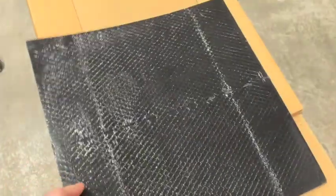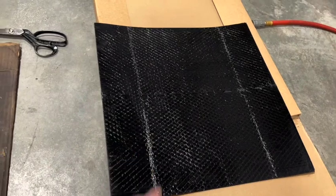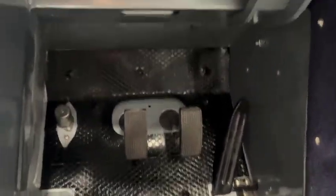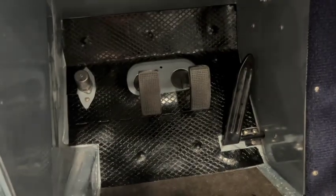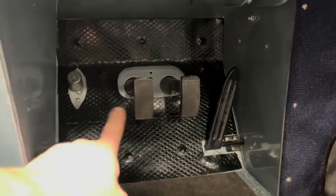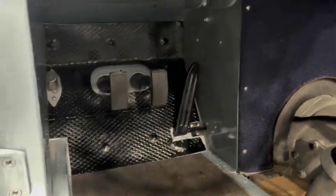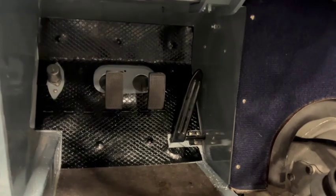They're just black on the surface, come in 24-inch squares, and are perforated down the center — really easy to cut with scissors. I'm taking my jute insulation, laying it on here, chalking it out, cutting it out, and making a mirror panel. As you can see I've put that one in — it sticks really well, just peel and stick, and you can nestle it down over the bolts for the insulation panels on the other side of the firewall. I've left the pedals and dimmer switch accessible in case they need adjustment, but the insulation panels I don't think will ever need to come off. Now I'm going to lay another piece on this side wall, and the same thing for the passenger side, then cover with the quarter-inch jute and finally the carpet pieces.